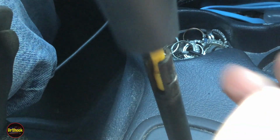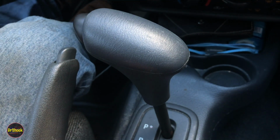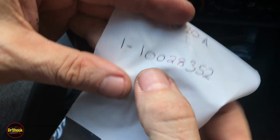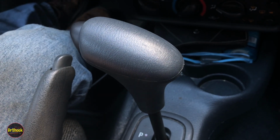So now we can just put this guy onto the new one and see he's nice and firm. And what we're going to do as well is we're not even going to reuse this old worn clip. We're going to put a new clip on there, and the clip part number is 1002-8352 from GM. And again, I'll put links in the description for both of these parts.